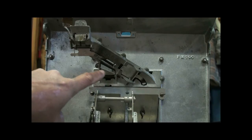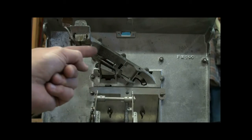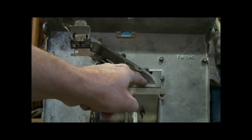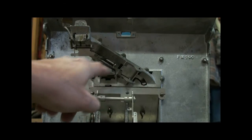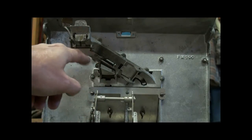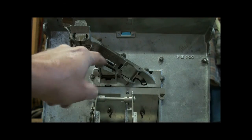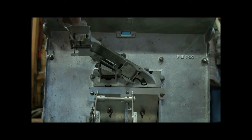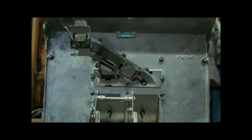As this little ledge becomes part of the bottom of this chute, nickels will continue to roll on and start filling up this second jackpot. Then when you fill up this whole jackpot, nickels come up here and push this forward to close it off, and when the next nickel sits on this lever and pushes it out, it moves this forward and all future nickels fall past and right down into your coin box — and that's the house's take.